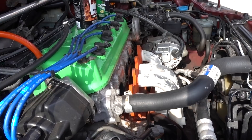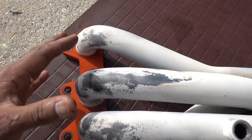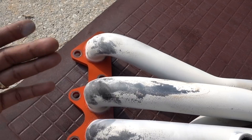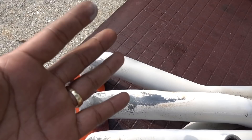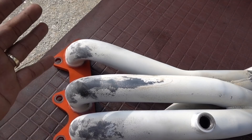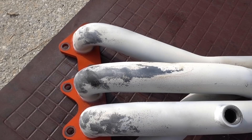Preparation is key. After I remove all the old paint, I'm going to use some alcohol to clean it, and then start painting. I'm probably going to shoot three coats — the first one has to be light, the second one a little bit heavier, and the third coat or maybe even a fourth coat depending on how it looks. I'm not going to show you in detail how to prep or paint since I already did that before. I just want to see if this paint is going to hold up on my headers.